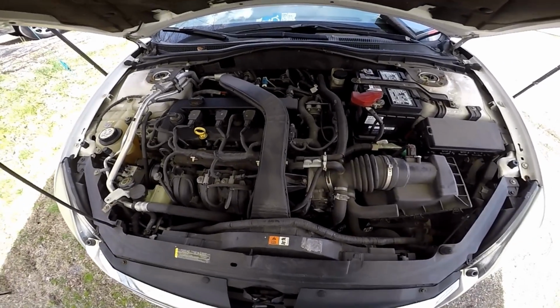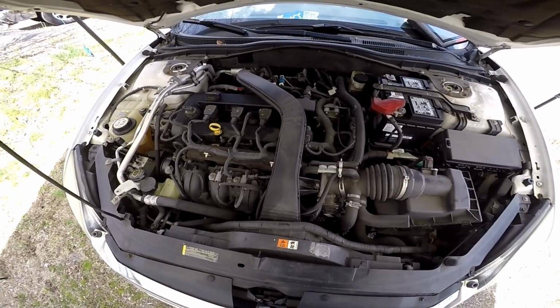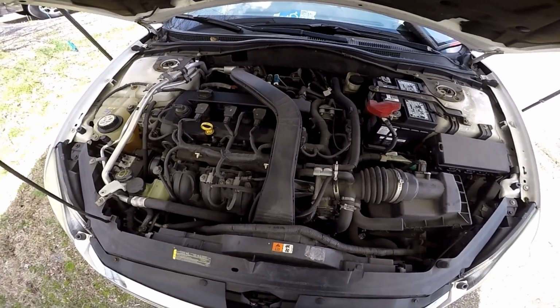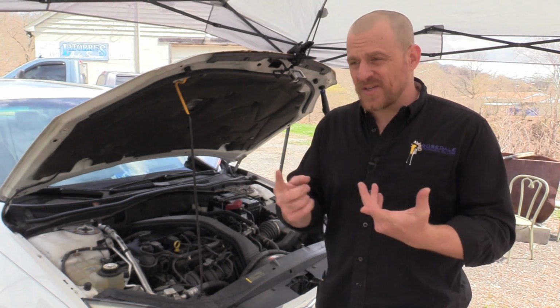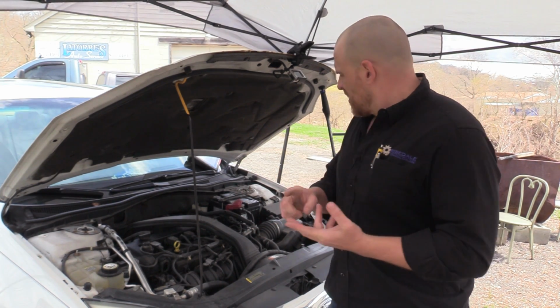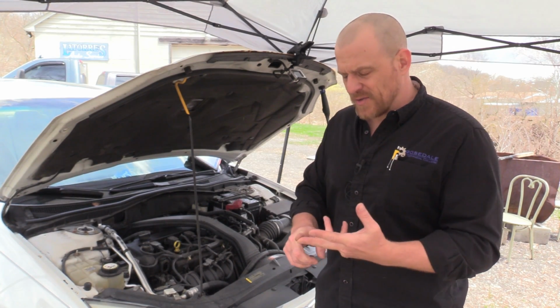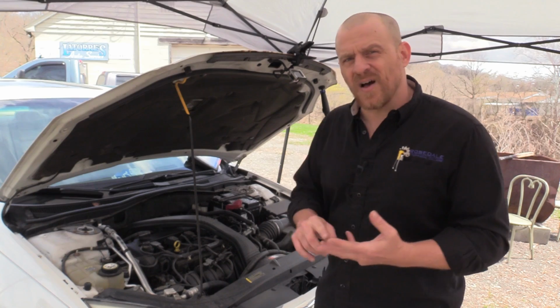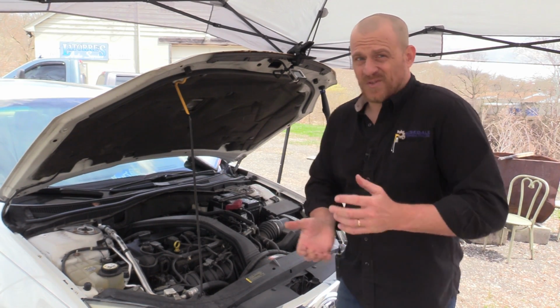You know, without looking at the flow chart, wiring diagram, and things like that, I want to try to attack this just off of common knowledge first. So by common knowledge, I'm talking about an electric air pump that's either power or ground side controlled. Talking about an electronic solenoid that is the same, either power or ground side controlled. Then we have some vacuum lines we need to look at, some plumbing. Pretty straightforward system, to be honest with you.